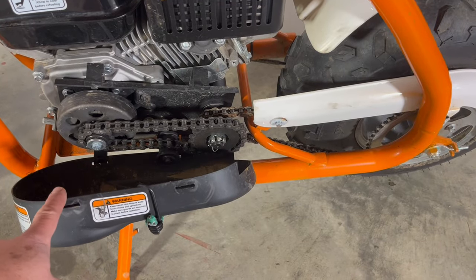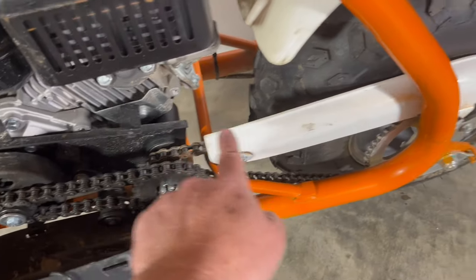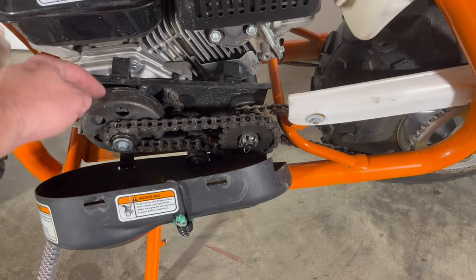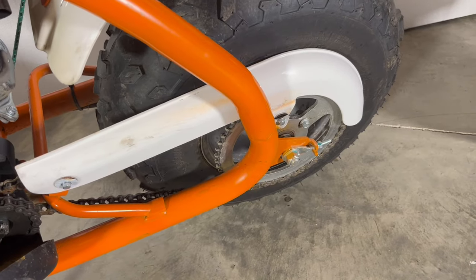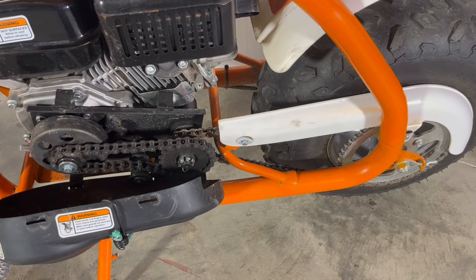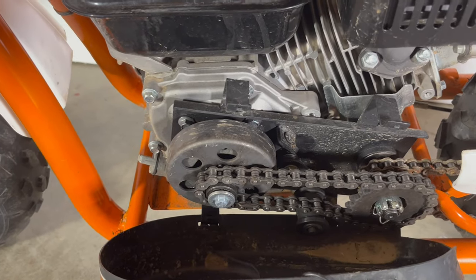Taking off the cover to show another option. There's the clutch, primary chain, jackshaft, and secondary chain to the back sprocket. You can remove the jackshaft, flip the clutch over so the sprocket's on the inside, and straight chain it all the way back to the back sprocket. Straight chaining is good if you only want top-end speed, but it does not give you very much hill-climbing torque. It will also melt cheap clutches like this, so you'll probably have to upgrade.